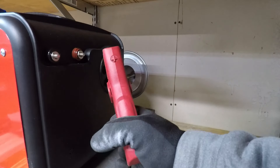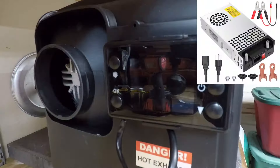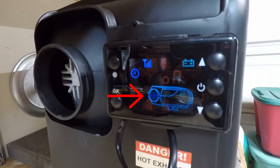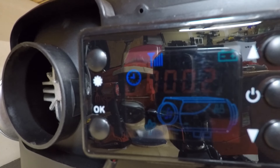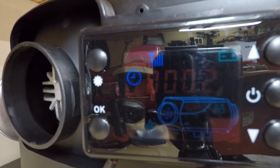I used a jumper pack I had on hand to run this thing through a startup and a full blast cycle, then a cool-down. I came back later and used a 30-amp power supply as the permanent power supply — you could probably do it with a 10-amp but I went with 30. You can see the fan indicator telling you that you've got power, and it's starting the fire-up cycle. The next light that comes on is the glow plug, and that's when it really starts to pull the most power — just over seven amps. There's the indicator for the fuel pump and you'll hear the ticking too. It takes about five minutes before this thing really kicks out any substantial heat, but once it gets going it puts out a pretty significant amount.